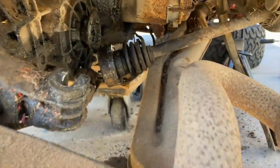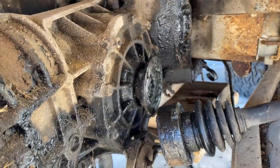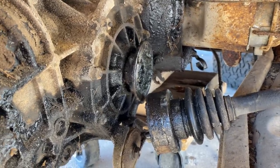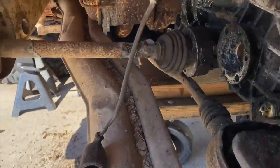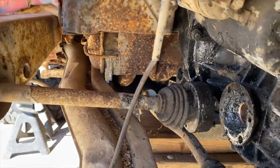Okay, finally, those broke loose. Yeah, it's just two dowel pins holding them in, but there was a lot of old grease and stuff just kind of seized on there. I tapped on this one on the outside pretty hard with the hammer and just kind of broke it free. And then on this one, I tapped on it with the screwdriver and it broke free. So the trick is gonna be getting the engine past those axles.